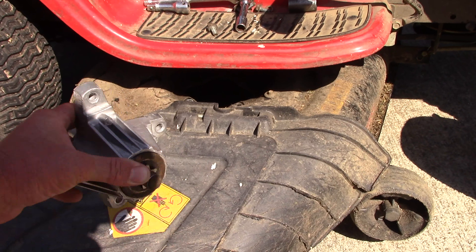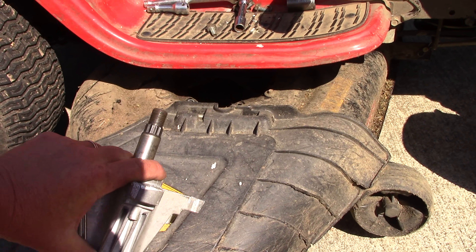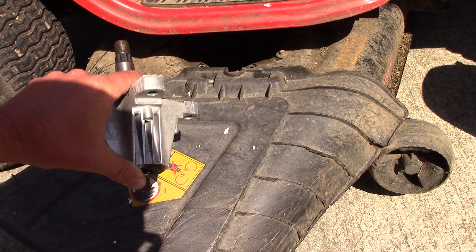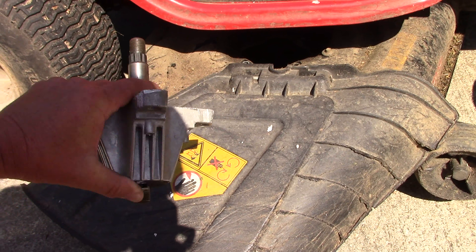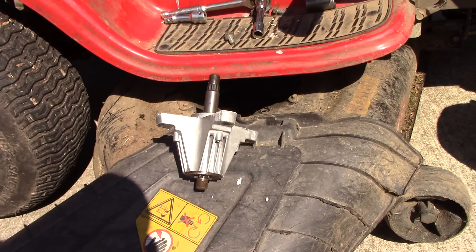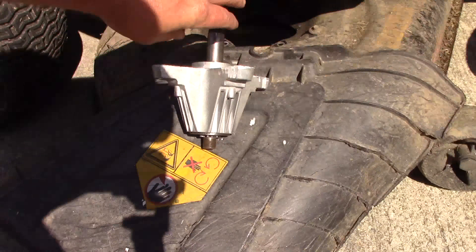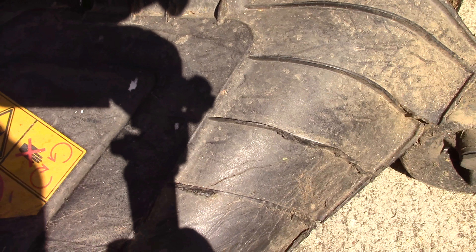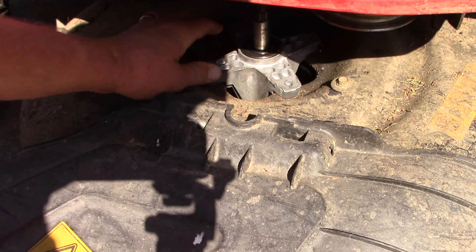Just in case somebody needs to know how to do it, we're going to put the pulley on once I get it bolted up — it's just easier for me to do it that way. Then I'll put the blade on. We're going to have to drop the deck all the way down, and you'll see that now. You're going to have four bolts — they're half inch.